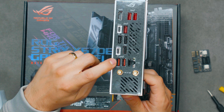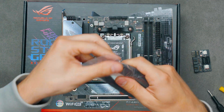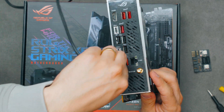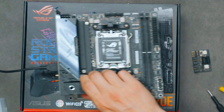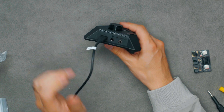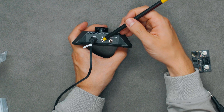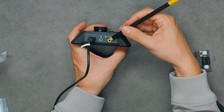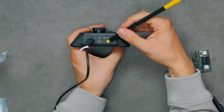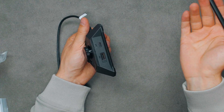There's a red USB Type-A port on the rear IO with a special connector cable for the Strix Hive. You connect the Type-A cable to the back — make sure you do this before the first boot. The cable slots into the side of the hive and now your motherboard IO is extended through this cool little device. The hive features a headphone and mic combo jack, a mic-in or optical out port — which is very interesting and I haven't seen this before — and the ROG logo on one side.